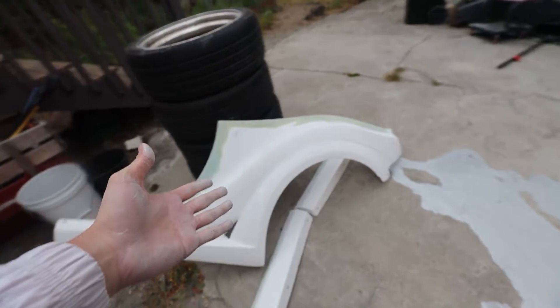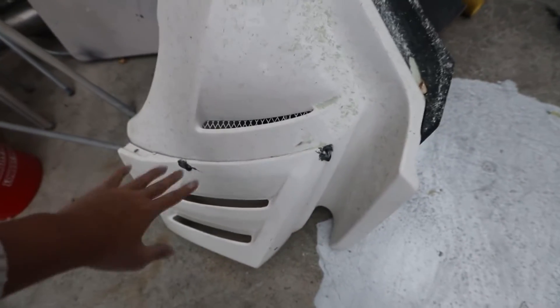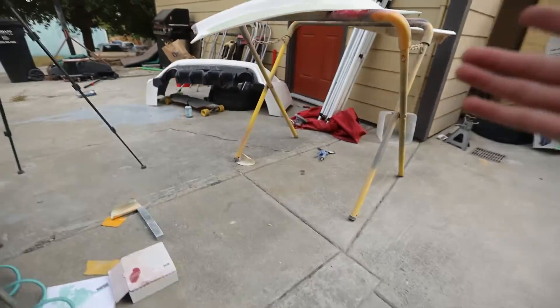The hidden hardware on this kit is officially done and we're ready for final sanding before primer — same goes for the quarter panel piece and the side skirts. I thought I was done with all the panels, but I realized I still have the rear bumper pieces. We got some panel bond already laid on this piece, so we need to sand it down and do body work to make that seamless too. I've been doing this for a few days now and I hate body work, but you got to see it through. Just like that, we got the extension pieces all finished — hidden hardware, baby.